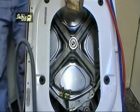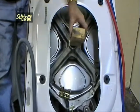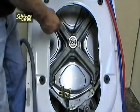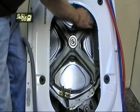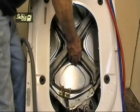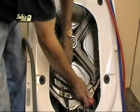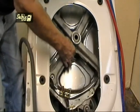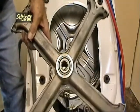Use a block of wood or mallet and hit the drum shaft just to free it from the bearings. Then once you've removed all eight bolts from the bearing frame it can be levered out from the edges and centre. Don't use anything too thin or sharp when levering the centre out or you could damage the rear of the container, which will prevent a good watertight seal when replaced. The arms on the bearing frame are in quite tight and it may take a bit of persuading, but it will come free. With a bit of twisting and turning it can be eased out of the cabinet.